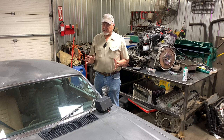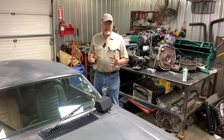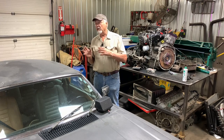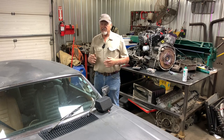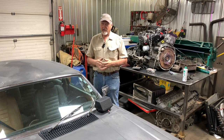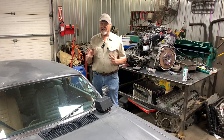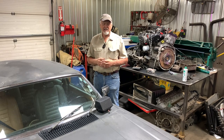Now, if you've been following the past few episodes, you know that I've been dealing with a heating problem on Old Tex. Things operate pretty normally for the first 10, 15 minutes, and then particularly if I stop someplace and let it sit a while, it's like heat soaks up from the bottom end and it starts hot and just gets hotter from there. So we've done a number of things, and we'll sort of recap that at the end of this episode, because really, we've only got two things left. One of them is a cooling system flush, and the other is the thermostats. If one of those two things don't pan out, I'm not sure where we go from here.